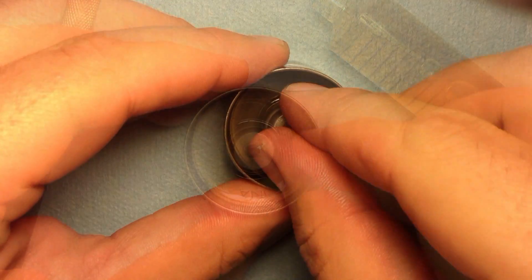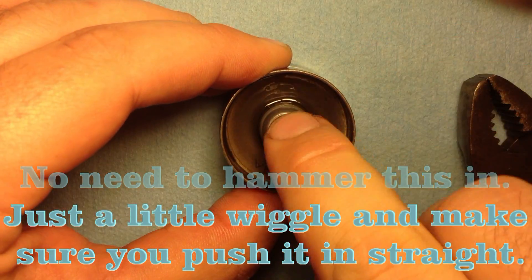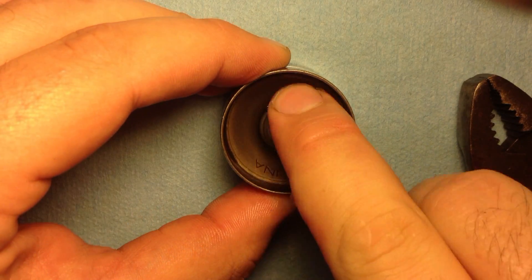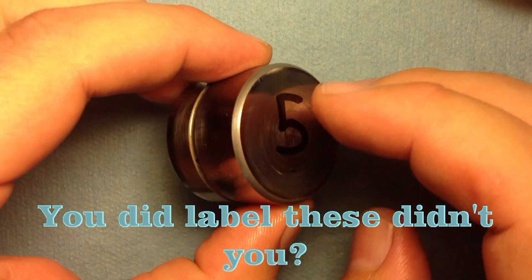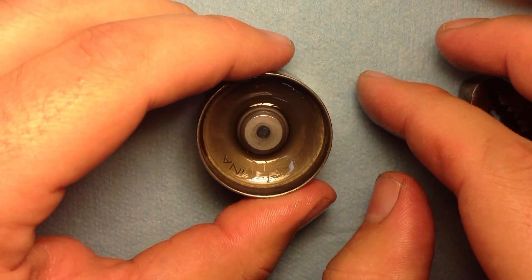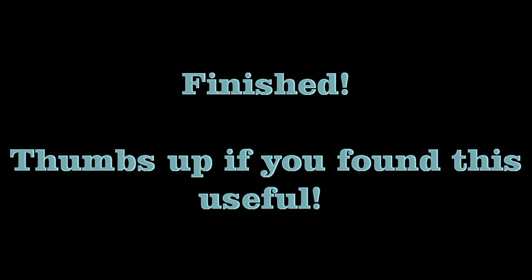So all the air is out of that check valve piston assembly. I lube up the tappet a little bit, slide it right in, and give it a little push to get it past that retaining ring that you worked so hard to whack out of there. And that's it. Notice I've re-numbered these and they're ready to go back in now. Thanks for watching.